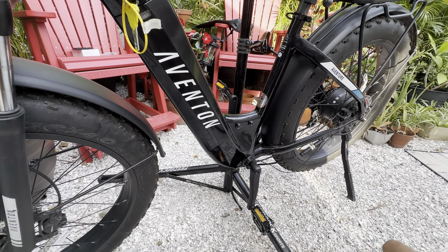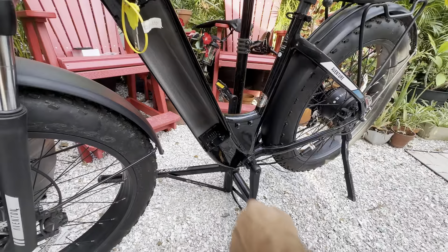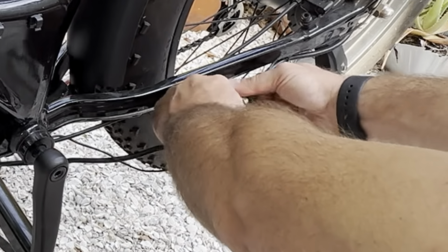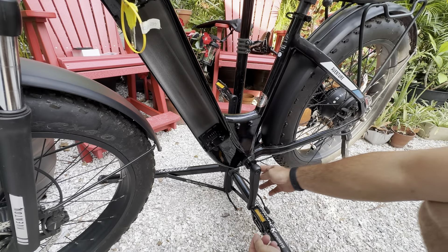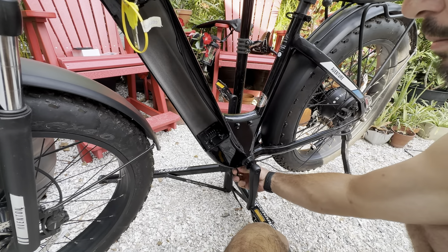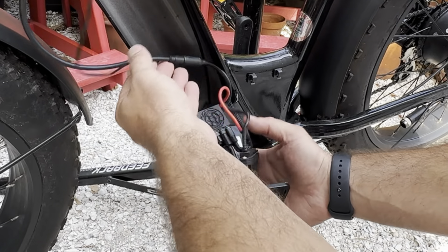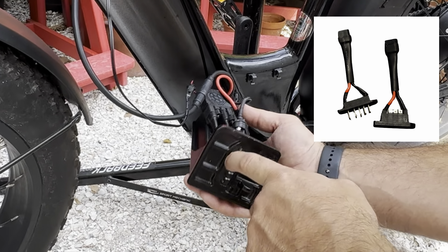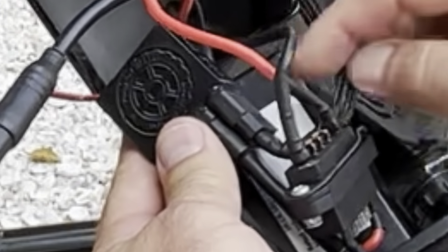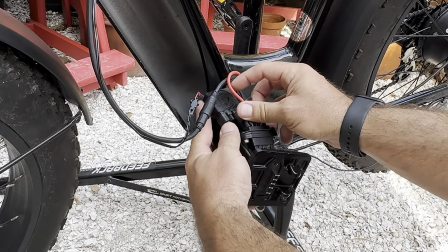Just to demonstrate a couple of things, we're going to go ahead and pull this out. Keep in mind we never hooked this back up officially, so the screws aren't in here — this is not the way your bike will be. You will need to do a full removal, and we have video instructions for that — we'll leave a link in the description below. We're going to pull our controller plate out so you can see the install. This is an adapter, there's another adapter used, here is the DX2, and then this is our extension cable out of the bike — and that gets us our second battery plug-in.